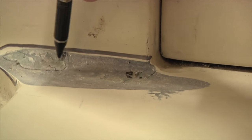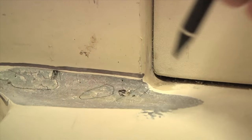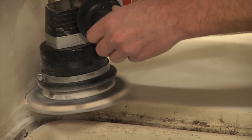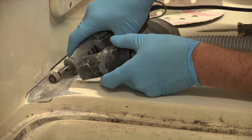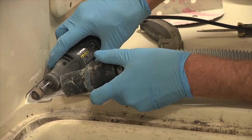So what I'm going to have to do to make sure this doesn't happen again — all these areas that I circled with a pencil on the close-up — you can see through the glass that there are voids underneath those layers of glass. So I'm going to have to come in and chip as much of this away as possible, give it a nice sanding, smooth it all over, and then I'll come back in and lay up all my glass to build this back up.